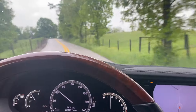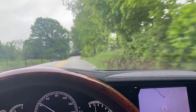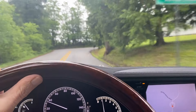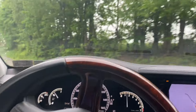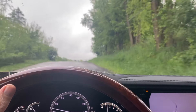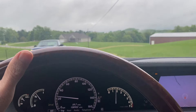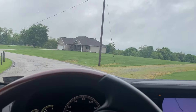On one of the front wheels on that same side, when I opened the bleeder, nothing came out. I had the system pressurized with a pressure bleeder and still had to get in the car and stomp on the brake pedal to push whatever was in there out. That's taken care of now — I've got fresh brake fluid in.